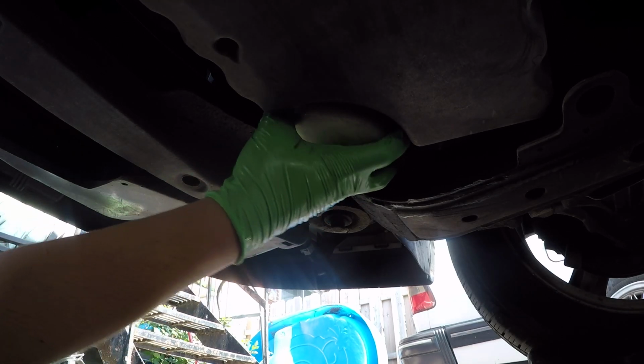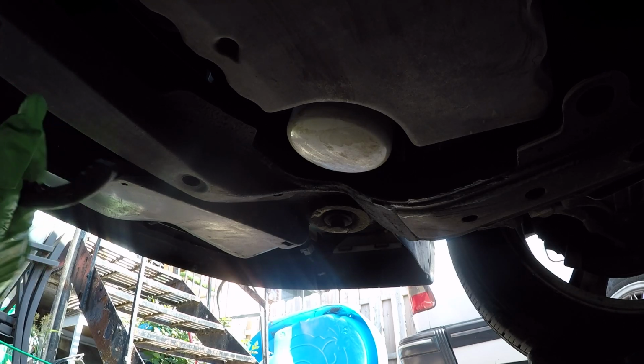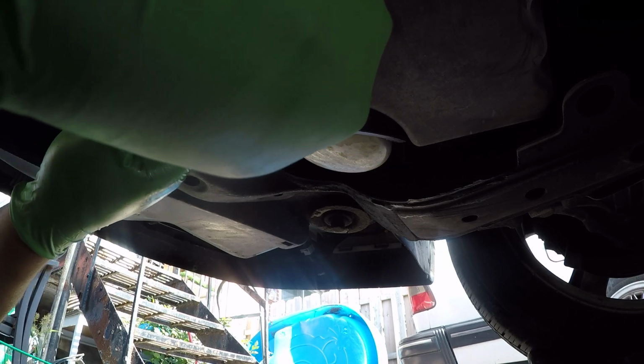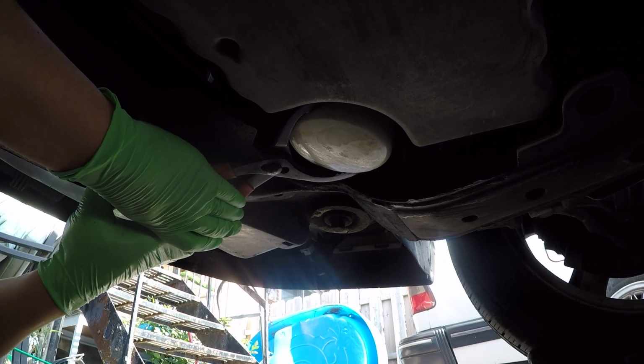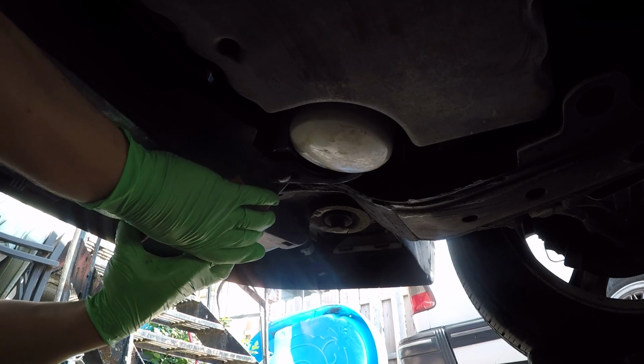I don't tighten these much, but this is probably going to be on there. We did about 10 to 11,000 kilometers in this oil change, so we're probably going to need to go ahead with our pliers here. You can use pretty much any type of pliers that fit in here to get this out. I'm going to use these oil filter specific ones. Just turn it lefty loosey, and that should not be putting up a fight, so that's good. It's coming out nice and easy.